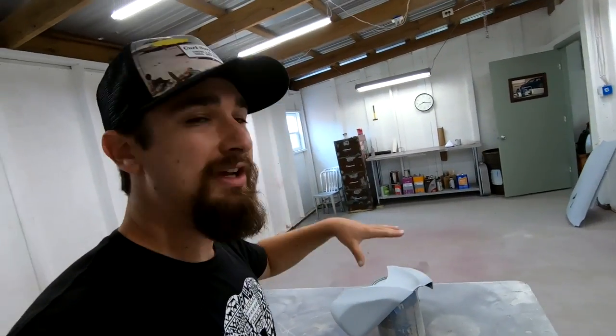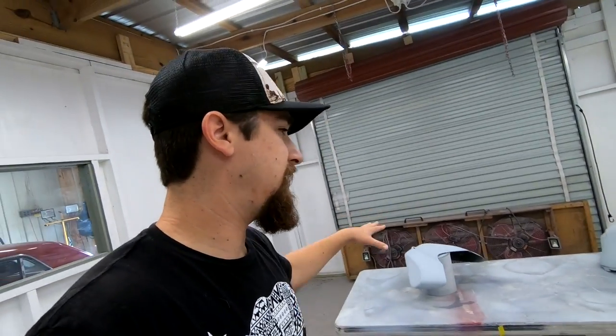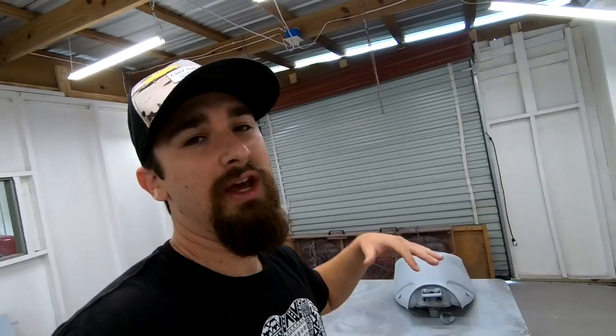What I'm going to do with these tanks now that they're primed is sand them. I like to finish with 800 grit sandpaper before I lay down my base coat. If they're really smooth I can just start with 800, scuff it, and make sure it's perfect and ready to go. If they're a little rough I can go all the way down to 320, so long as I don't break through the primer. These I'm going to sand with 800 and then lay down the nice beautiful blue base coat.